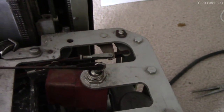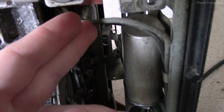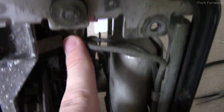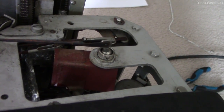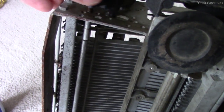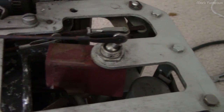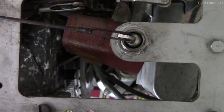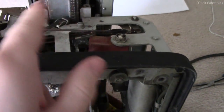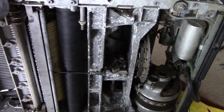Here's the power switch reinstalled - it's got a little cardboard insulator on it to prevent anything from touching it. The linkage is reinstalled and the two cloth-coated wires are screwed in with nice little eyelets, tucked well away from harm. Now when I flip it from the front you can hear the switch making contact, and the key protector is moving in and out on its own. One interesting thing: the switch doesn't actually go in square - this linkage is on an angle, so the switch has to go in at an angle to avoid fouling on the bar.